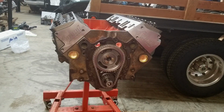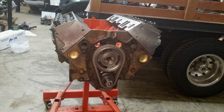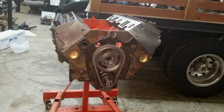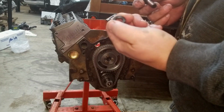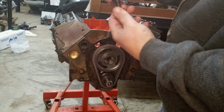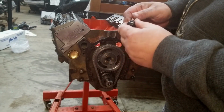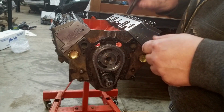So you do have to clean and prep them a little bit. They are not run ready. They don't have rocker studs mounted in them, so you've got to do some assembly work to make them all kosher. Now also keep in mind, this is real important with small block Chevys in particular, I'm using ARP head bolts. They have a taper on them, where the shoulder of the bolt goes in, so that it's a nice clean flush sort of setup. These go through the water jacket.